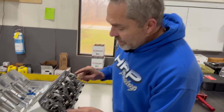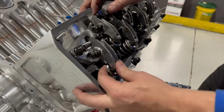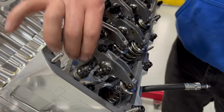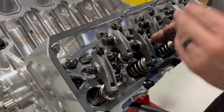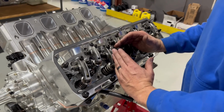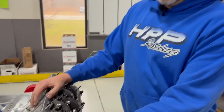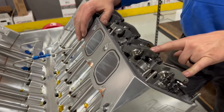Okay, so what we have here is we just have a checking spring on each rocker arm. They probably got 5-10 pounds of pressure, so that's nothing. Because we're talking about all the excessive spring pressure that this used to have, but the cam lobe really is the problem. The excessive spring pressure just kind of multiplies itself on the bad lobe design or the wrong lobe design. Might even have been an accident. I don't know, but it might have been something that just wasn't intentional. But we did find it, and I wanted to show you something pretty interesting.